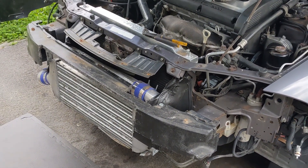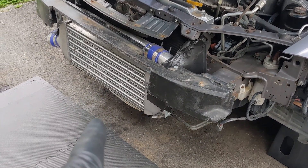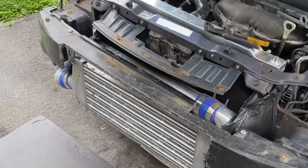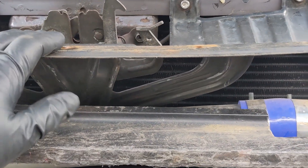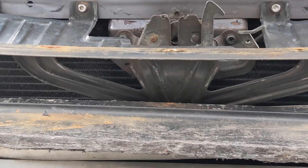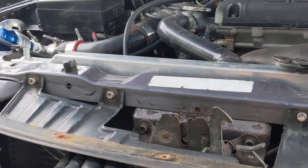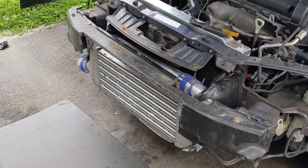I'm not using the normal recording means so forgive me if the frames are a little different. We're going to go under here and try to take some sheet metal. Back when we installed this, we put a big piece of angle iron on the bottom and that's what the intercooler basically sits on, so we're going to try to build off of that. I'm also thinking about cutting off the bottom leg and outer leg of the hood latch bracket, leaving the center section bolted to the core support and building something that will direct airflow in through here, up and back into the top of the radiator.